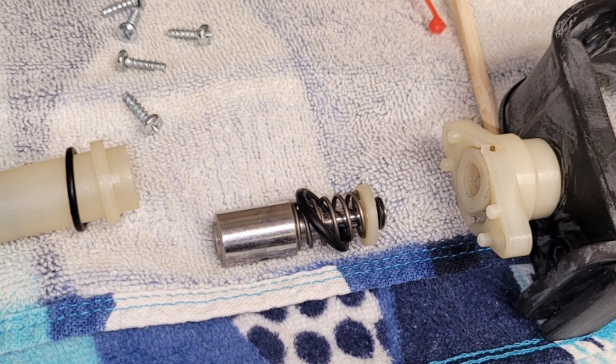One more side note: in all those parts in that little piece that goes on the top of the pump, there's a tiny spring with a ball on the end — like a tiny little plastic ball, like a plastic BB. So be careful when pulling it all apart that you don't lose it. The spring is beveled — the fatter side goes into the body of that plastic piece, and the skinnier side is towards the opening, and that's where the ball sits as well. I'm not sure you can see it in the picture, but just remember there's a tiny little ball and spring among all those parts. And I used a little bit of O-ring lube on some of the O-rings putting it back together, though I'm not sure you have to.